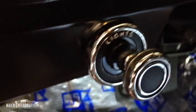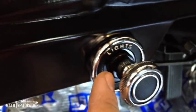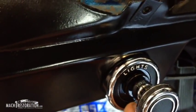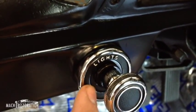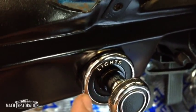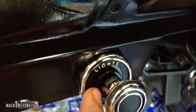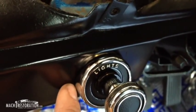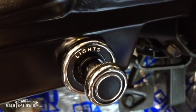The first thing is these are all held in with bezel retaining nuts right here that you can see — I painted mine black for a reason. These nuts rest against this metal edge that actually comes with the bezel. On the 70 model Mustang it's right here at the surface of the chrome, but on the 71 through 73 the bezel retaining ring is actually more recessed in the bezel. This creates quite a problem, especially when you get to the headlight switch here, which is what I'm going to focus the video on.